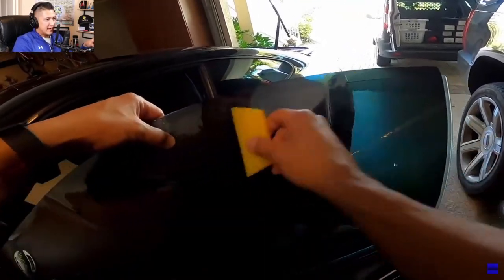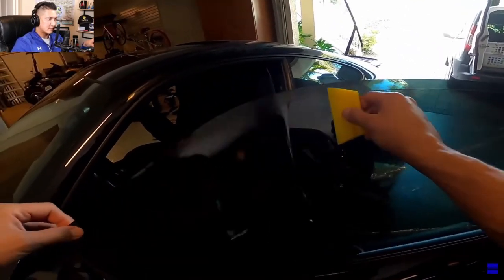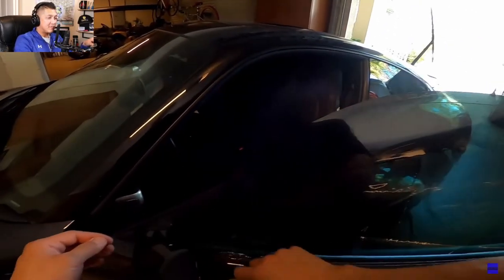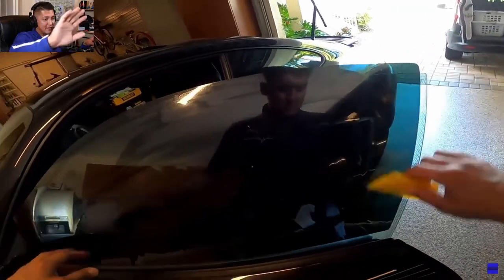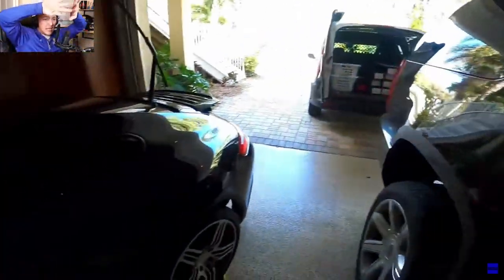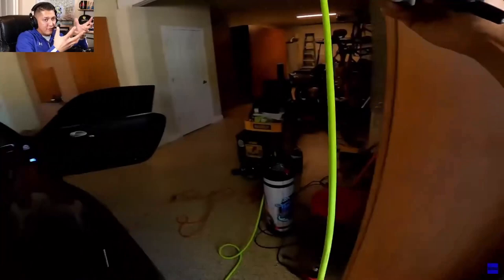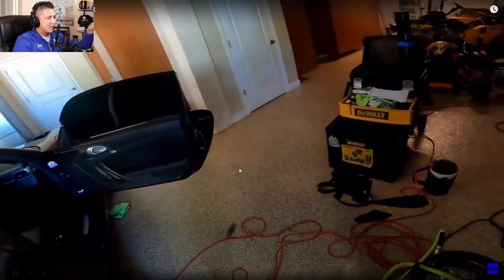The most important thing as I lay it: I try to lay it from the top and squeegee across the top first so the top is fully flat, then I just bring the sides down. You're going to do that horseshoe squeegee at the top and bring it down, bringing all the fingers to the very bottom. I've already done it on this side.